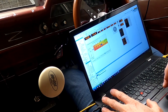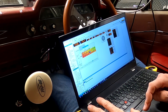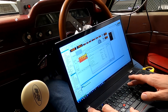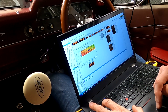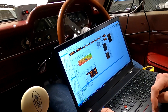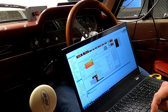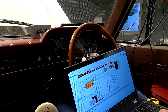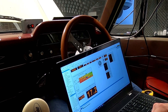I'll put the camera on it, and then we'll map first gear, second gear, third gear, fourth gear - doesn't really matter because it's going to be incredibly fast, and lock up doesn't matter because you're not shifting out of fourth. Can you make it big? Put an RPM next to it and I'll map those - that'll give me speed and RPM in first, second, third, and allow me to look closer at shift points. There's a definite shift at 6400.